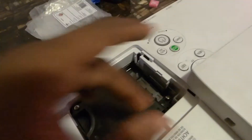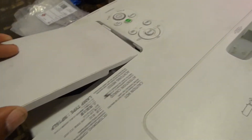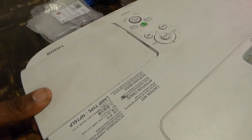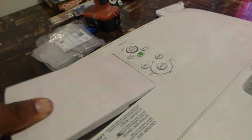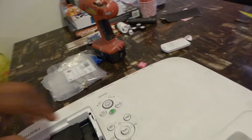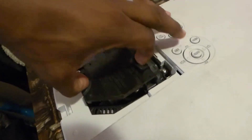This is the old one — I had to order another one. You just drop the screws in. Done. You take your panel, put it over top like this. Make sure it clicks in there. It might rise up a little bit if I don't have it screwed all the way down. You put your panel in like so and that's it. Then there's a little screw — some of them have screws, some of them lock in depending on how your projector is set up by the manufacturer. That's all you have to do to change the lamp. See the two sides right here — boom, that's it.